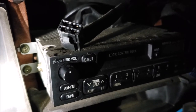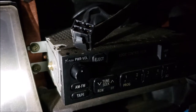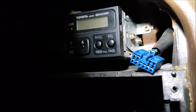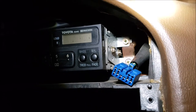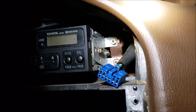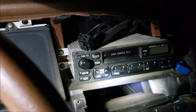And of course that lines up, and it's got to be in perfect position to line up with the bezel. And if the bezel's in the way, you can't get to the fasteners, which you can't tell from the video, but those fasteners are really deep. They're tight. You're going to have to crack it with a socket. They're 6-point and they're Phillips, and then use a magnetic Phillips bit to loosen it. But I don't know. We'll see.